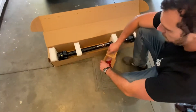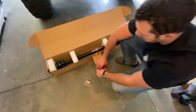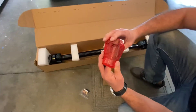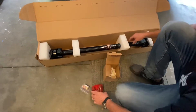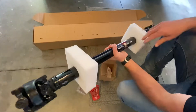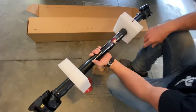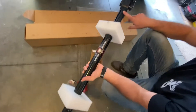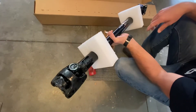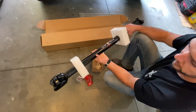Let's go over what's in the box. You're going to get a hardware baggie with some red Loctite, and then you're going to get your output shaft flange — this is for the transfer case end. They packed this real well, and they must have made this to order because it's still a little tacky on the paint. It is greasable as well, and it looks like they did a pretty good job balancing it too, so we shouldn't have any vibrations.